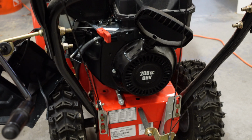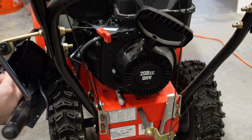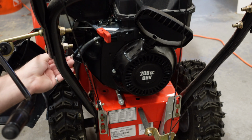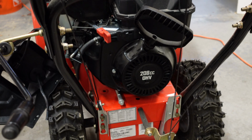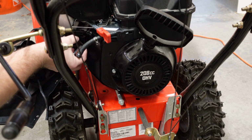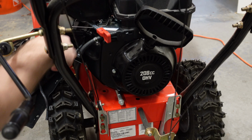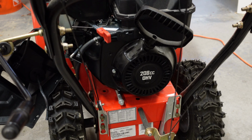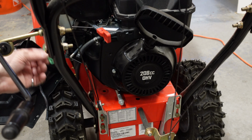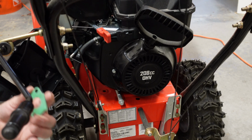There's two of them. One goes on the inside, one goes on the outside of the carburetor. Here's the one that goes on the inside. There it is, and then here is the replacement. I bought two replacements just because if I was replacing one, because I lost it, I had to order it, I bought two of them. I also found out that the Craftsman is made by MTD, so this is actually an MTD gasket. Let's go double check. Perfect, exact match.